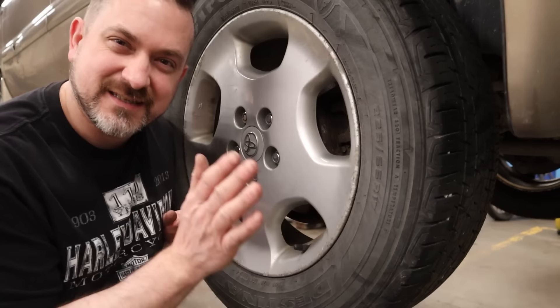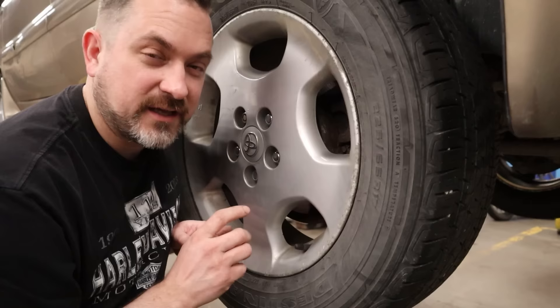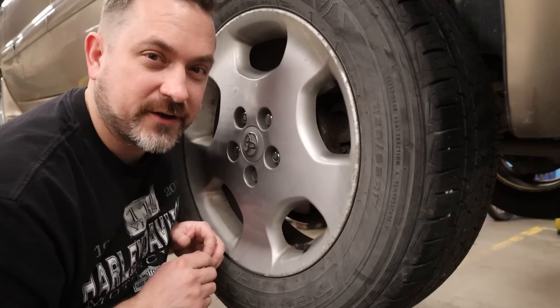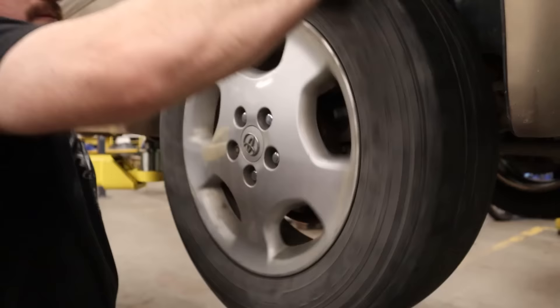Another final way to really confirm a bad wheel bearing: remember there are little ball bearings inside that are supposed to make this thing absolutely frictionless and really quiet with no play. When it's spinning and making noise, it's because there's play, dirt, debris, and damage inside that bearing — it's literally not rolling right. If it's really bad you can manually spin it by hand and hear what it sounds like. You're not listening for the light sanding or scratching sound of the brake pads; you're listening for a tumbling rocks, growling sound that gets faster the faster you spin it.